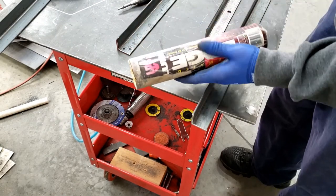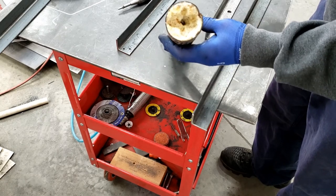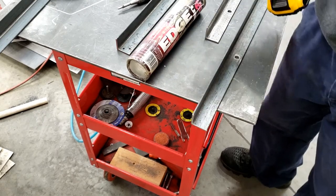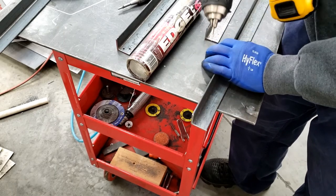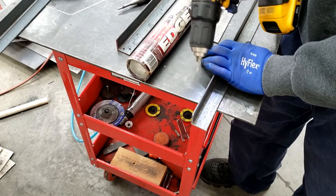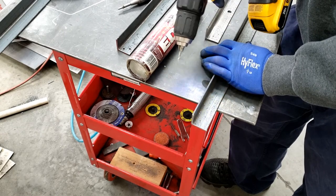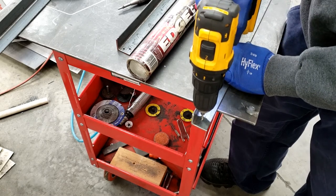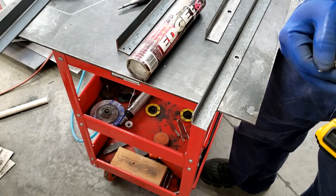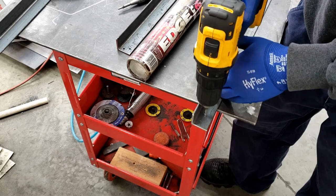And I also use this LPS edge wax. Use it for center drills and for tapping, especially. Works good for drilling everything else. But with a center drill, you want to make sure it's well lubricated, and not with something like WD-40. You need something better, like actual motor oil, or this wax, or something heavy that isn't just going to run away or evaporate. WD-40 evaporates so fast that it's about useless as a lubricant or a cutting oil.